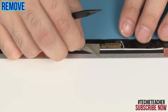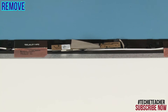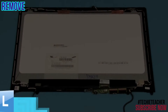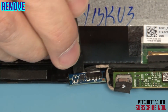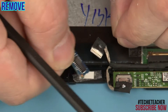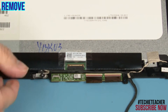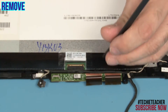Peel off the conductive tape. Peel off the camera board from the cover. Disconnect the camera cable. Using a pry-in tool, carefully detach the board. Disconnect the cable. Disconnect the EDP cable. Disconnect the two flat cables. Peel off the board and remove it.